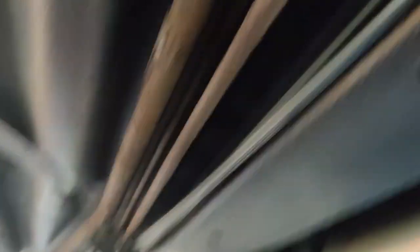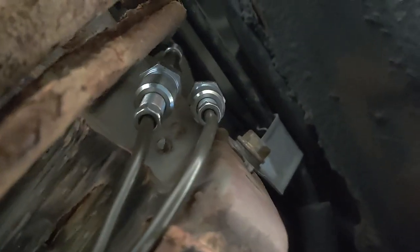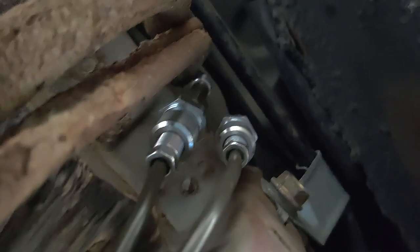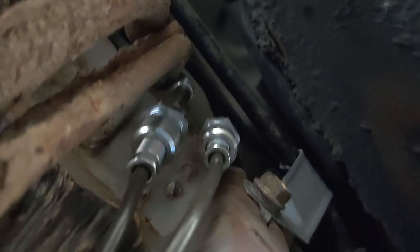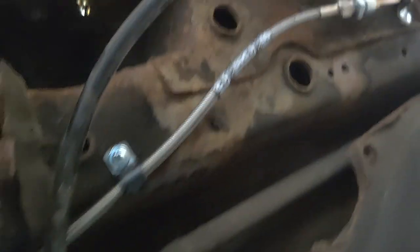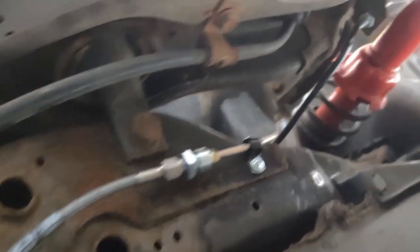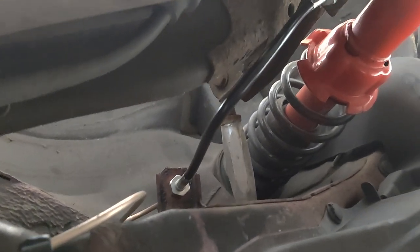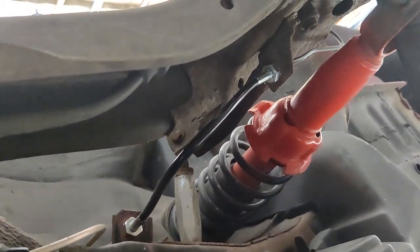After you come down along the bottom of the vehicle it comes up to two more fittings and some more braided lines. The reason I went with braided lines back here is because the lines snake between the gas tank and the body, and it would have been very tricky to get hard lines in there. I had two pre-made sections of AN lines — the one going to the driver's side is a 24-inch section and the one going to the passenger side is a 36-inch section. After that, the lines travel underneath the frame rail through two more P-clamps and then adapt to more hard line that takes them up into the wheel well to the mounting tab.